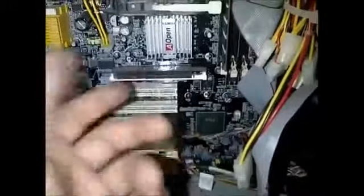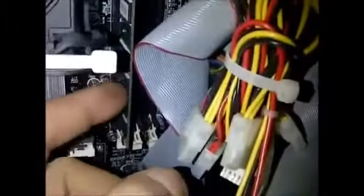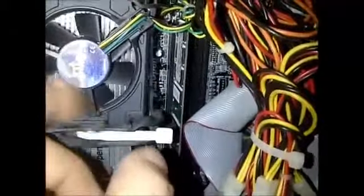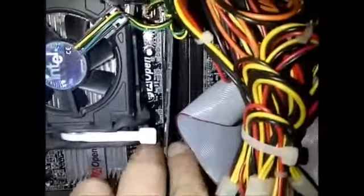If there is only a video card and that's your only video output, you're going to have to leave that plugged in. You also want to unplug your RAM, which is right here beside your processor — the processor will always be the big heat sink in the middle, usually with a fan on top. Your RAM will have little trigger clips; push those in and the RAM chips come out.